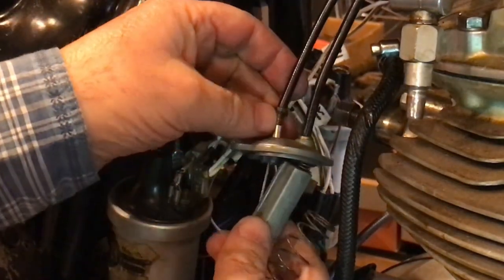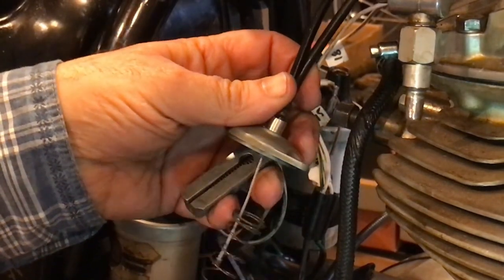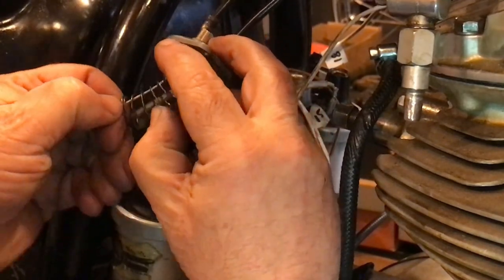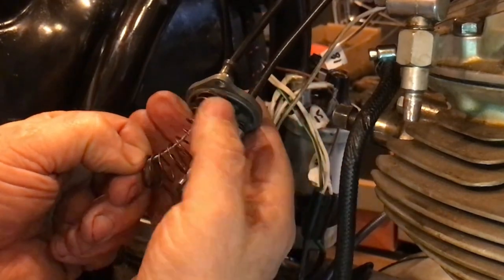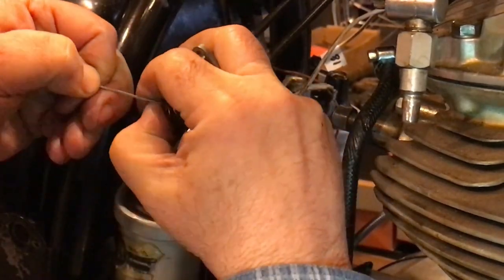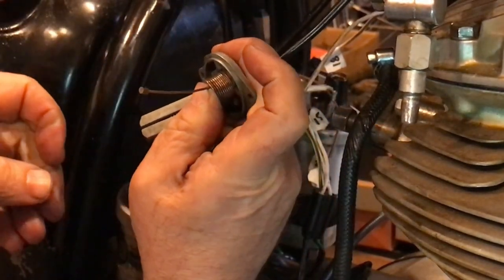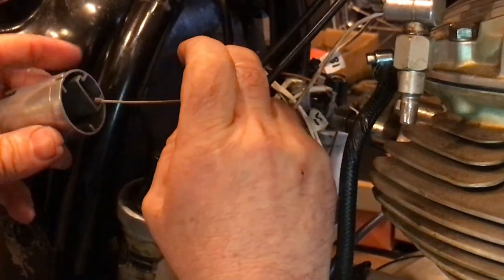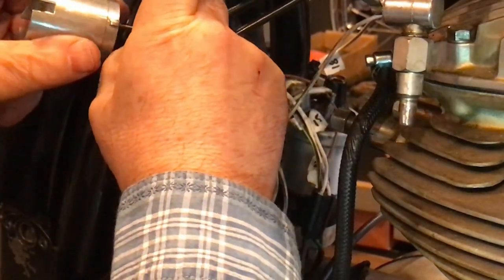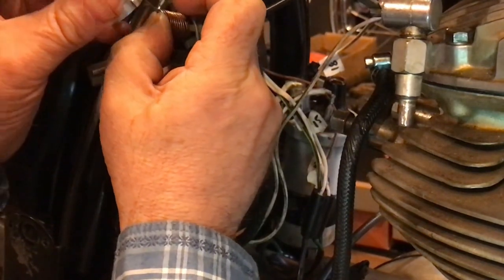It's sort of a sequence of events. Take the cap and the spring that goes around the throttle cable. What we want to do is compress that spring — essentially grab the throttle cable. There are little clamp tools you can get for this, but if you can just clamp it with your finger and thumb, sort of concertina it all up, the idea is to get as much slack in that cable as possible. Then grab the piston, put the cable through the larger of the two holes in the base of the piston, and move it across so that it locks into the other notch.